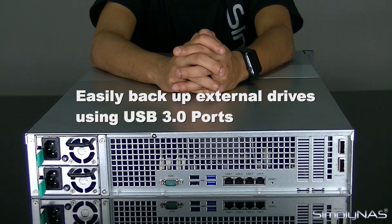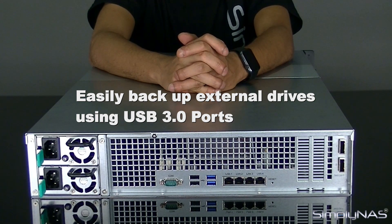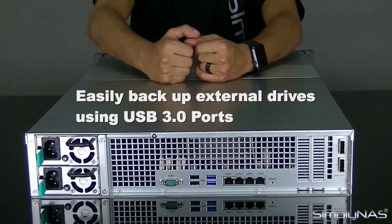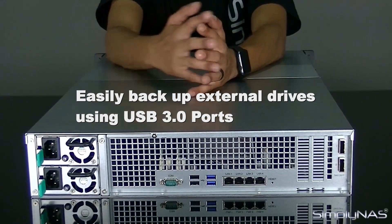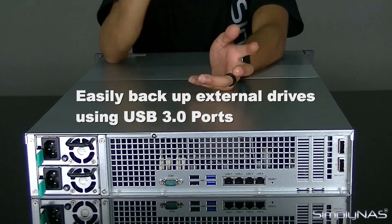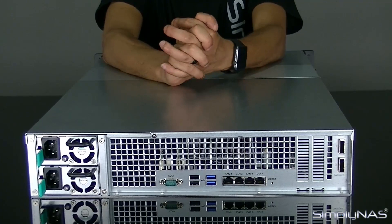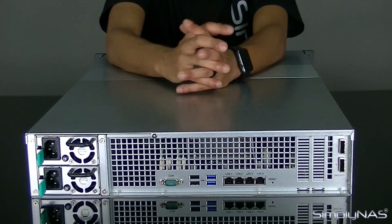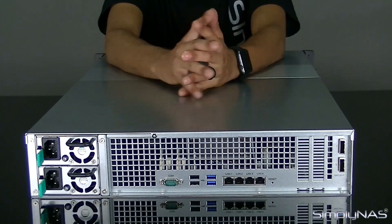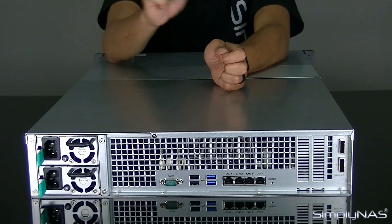If you've got certain files you want to double-copy, the external hard drive is very useful. It's also great for people out in the field — typically we send them out with external drives to save data, then they send it back in and you plug it in at the back and let it back up. Once you've done the backup setup in the web GUI once, it will re-recognize that hard drive every time you insert it and do the backup automatically. That's a great feature, especially when you're out in the field — it's really the easiest way of getting data onto the NAS rather than having to drag and drop from a PC.